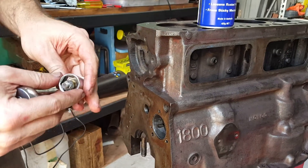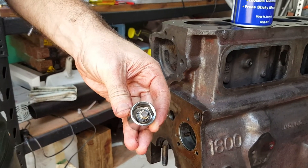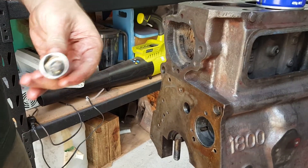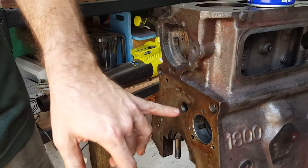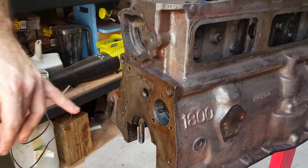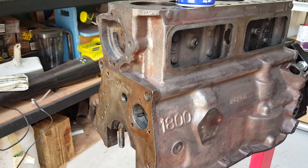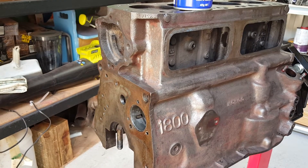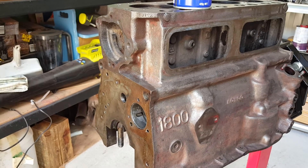There you have it — the brass plug gets pulled out. You just put it in a vise and unscrew it, and that way you can access the oil galleries with the cleaning tools and cleaning brush. There's another one at the other end, and you can clean them all out in case there's any sludge or build-up from however many years since the last rebuild.